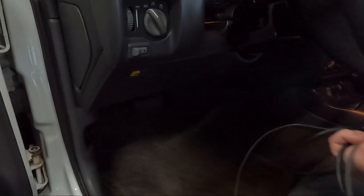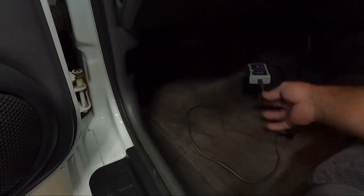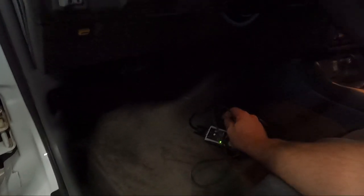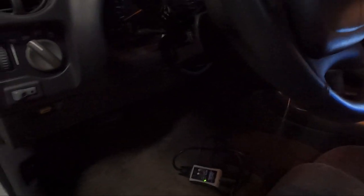Just because the tinted windows make it really dark — I should have done this video before I had them tinted. Alright, under your dash you're going to have a diagnostic port. On these cars it's over here on the right side. I'm using my old-school HP Tuners cable — the new ones, there have been two versions since this original. It's the Pro Suite. I'll list the newest version down in the description. Once plugged in, you should get power — I always like to plug it in here first to confirm power. If you're not getting power, generally that means a fuse is blown, 99% of the time it's the one for the cigarette lighter adapter as they run on the same circuit.